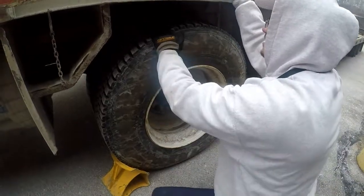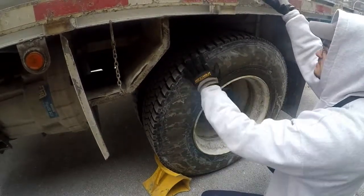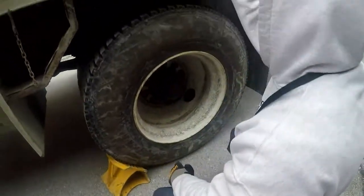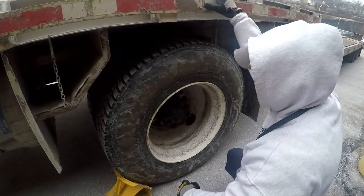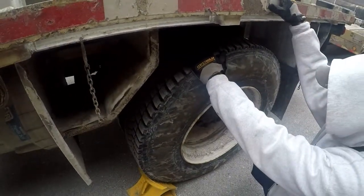The condition of the tire, there are no cuts, bulges, or abrasions on the sidewall or the treads. There are no threads showing. You can check inflation with the valve stems. Each tire has one. You can use a pressure gauge to check the pressure in each tire. The depth on these tires has to be at least 2/32.